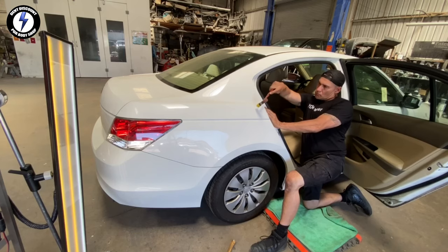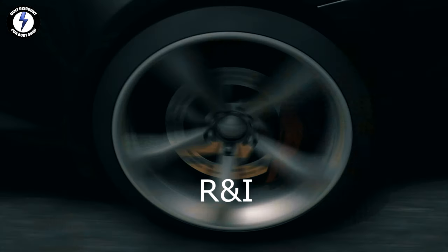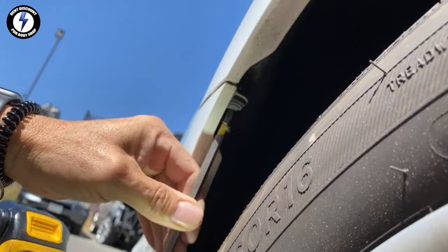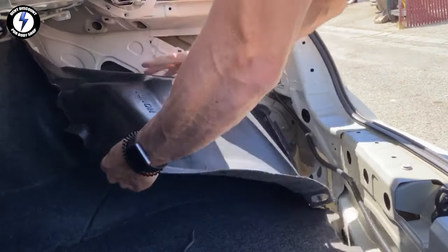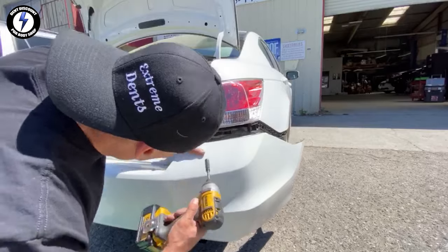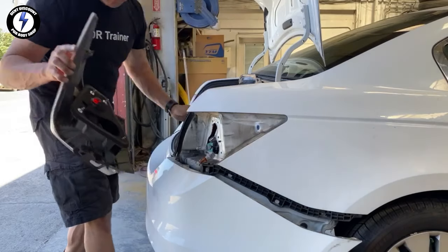I'm going to do another round of blending by manipulating the panel using my knockdowns and hammers to remove the high spots. The entire quarter panel was dented, requiring lots of extra blending. My sixth step: I'm going to remove some parts to gain access to the back side of the panel — removing three screws on the bumper with my impact drill, removing plastic interior clips, popping off the trim and pushing back the interior. There are two 10 millimeter bolts under the bumper, and four more nuts behind the light that need to be removed. Removing the wire harness, and off comes the light.